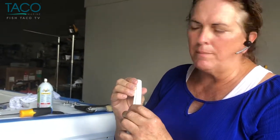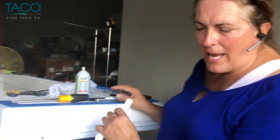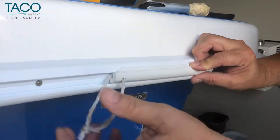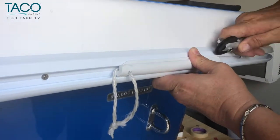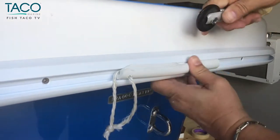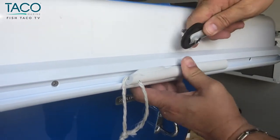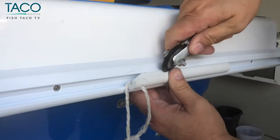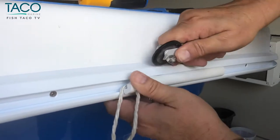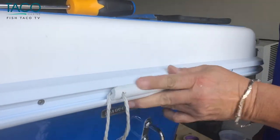I've developed a little system where I made just a little pipe with a hard plastic roller. You set the bottom in position and then work the top in with your roller to ease it in. Then you just push it the rest of the way in using the old method — your thumb. That seems to save your thumbs. And as long as you're using plastic, even if it marks up the rail a little, it'll clean right up. That's just a little trick to use to get the rigid insert in.